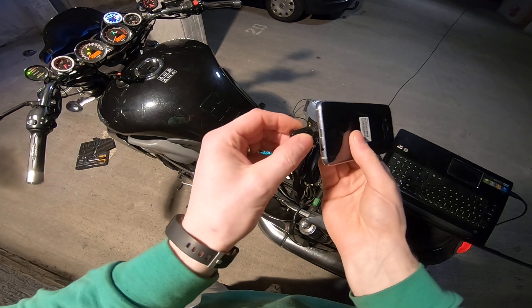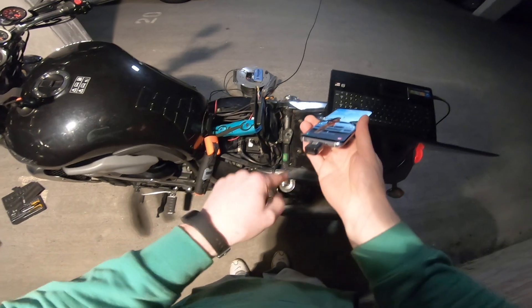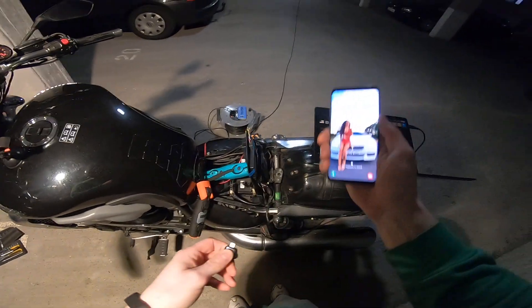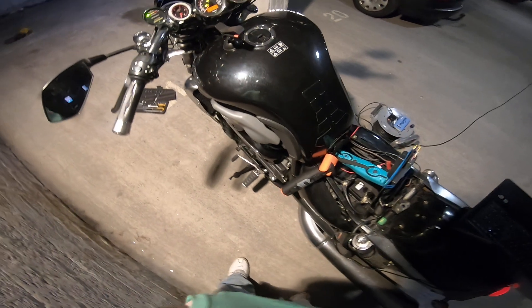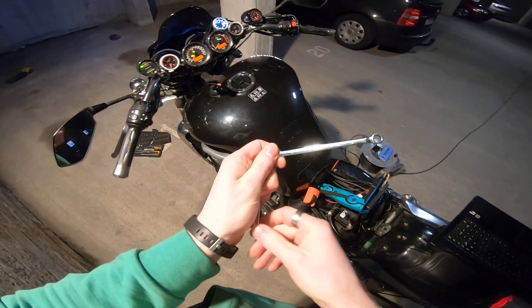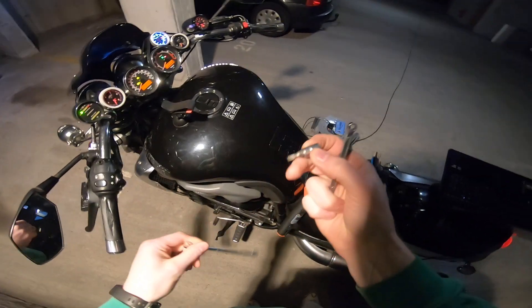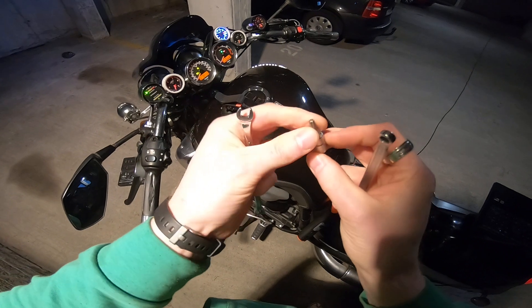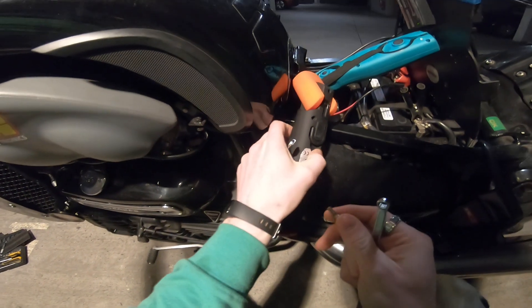If you're going to use your phone you can use a Bluetooth connector. I just have a phone and a USB Type-C adapter so I can plug this Lonelec cable in. You're also going to need a work light so you can see what you're doing, a seven millimeter spanner for adjusting the idle stepper motor nut, and a T25 Torx or star bit.